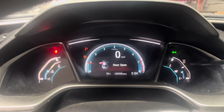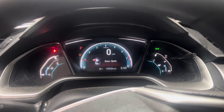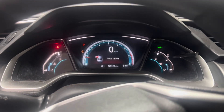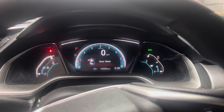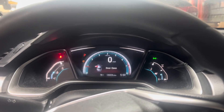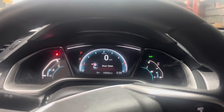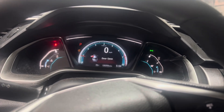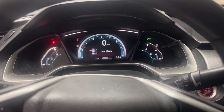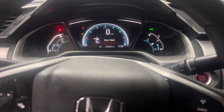I'm going to drive it tomorrow and look for it. If there is a code, we know for sure there is a problem that we have to look at. If it's intermittent, it could be wiring or anything. But for now, this is the information on the battery sensor — how it works and what values you need to see. If you don't see those values and there's no communication, the wires going to the alternator and engine computer need to be checked and fixed. The car was dying — we fixed that problem for the code we had, and we have to follow through with programming the engine computer. We'll talk about it later. Thank you very much.